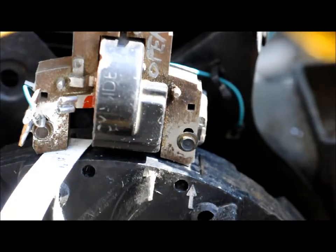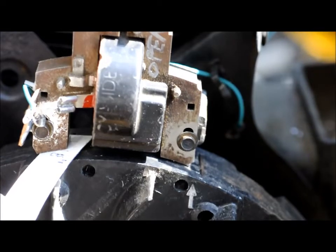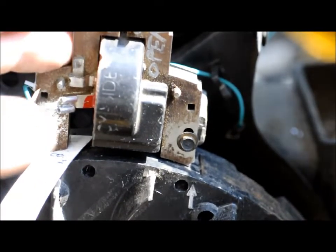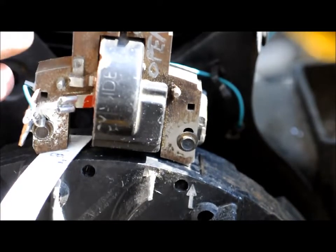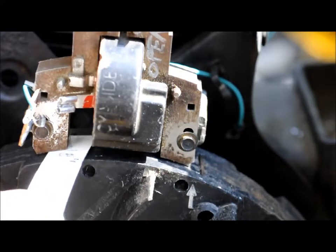That terminal post is connected to the green wire that goes off to the ignition coil. Before I mounted the ignition coil on the engine, I ran it on the engine simulator. In both cases I have a piece of scrap aluminum, about 18 thousandths of an inch, that I use as a shim to set the air gap between the trigger coil — which sort of looks like an old magneto — and the flywheel. With that air gap of 18 thousandths, the first spark, the advanced spark, occurred at 290 RPM, which seems just about right.